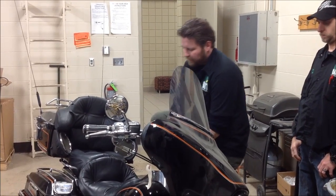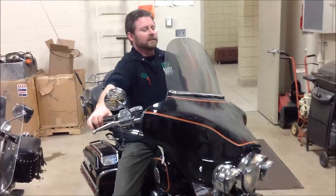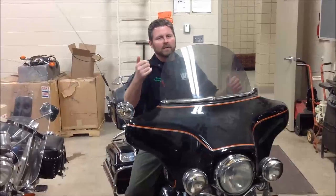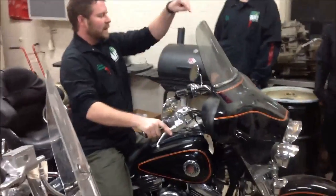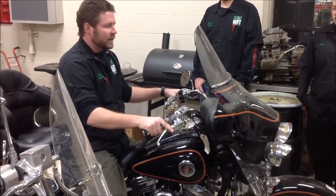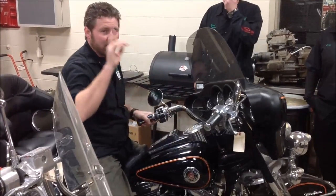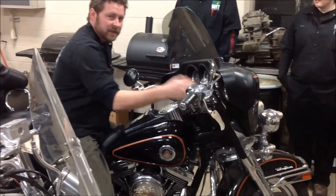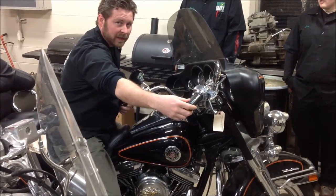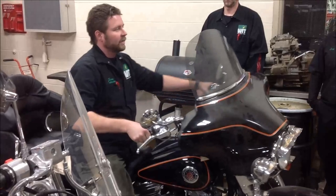Here's the reason why: once I put this on a motorcycle lift, I ruin my ability to check cables. So let's get in here, kind of from a distance, and grab this whole area. You've got to remember, once I clamp that wheel into the motorcycle lift, can I do this? No. This is the overlooked item. All you mechanics need to know that these cables have routing, and that the free play in cables or even in clutch levers is going to change from lock to lock.